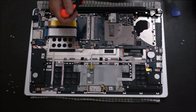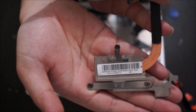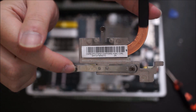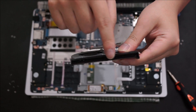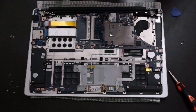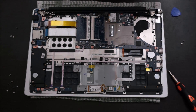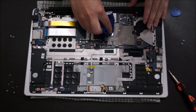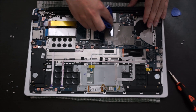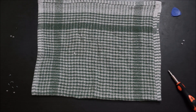We're going to have to clean off the old thermal paste from the heat sink and from the CPU as well. The screws have numbers on them — number one, two, and three — and by following the screw numbers when putting it back, it spreads the thermal paste evenly. The dust normally builds up here on the heat sink. Just wipe and clean the old thermal paste with a cloth or tissue — try to use a cloth as tissues break apart.